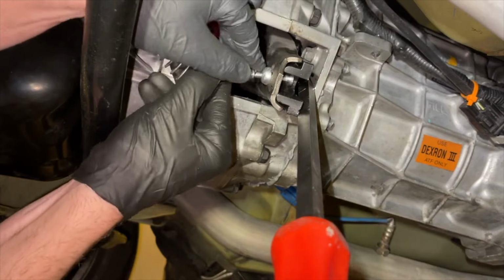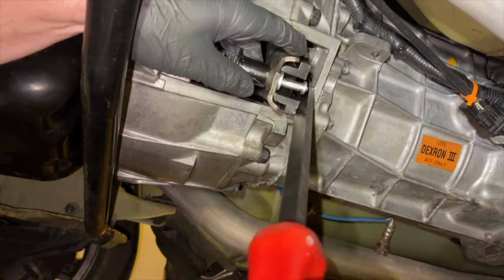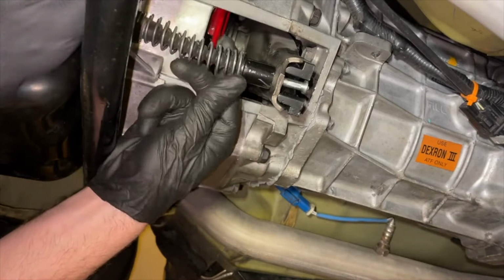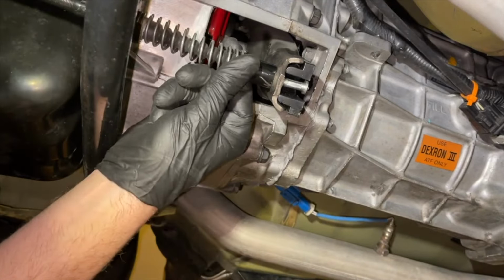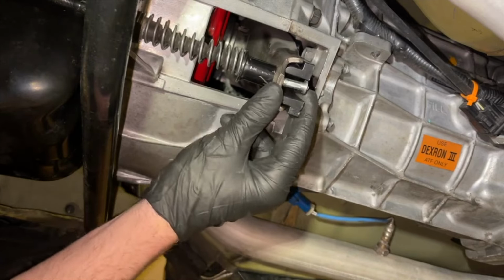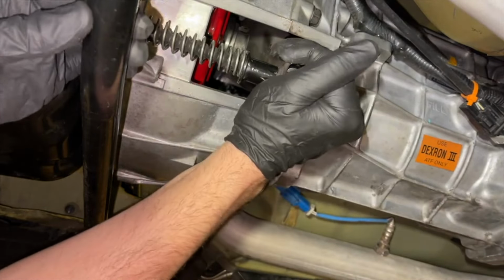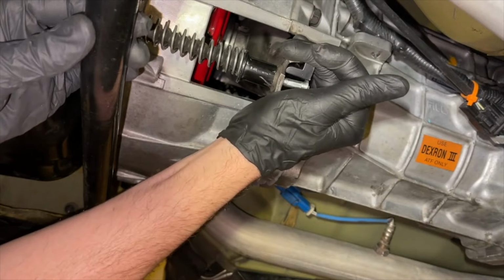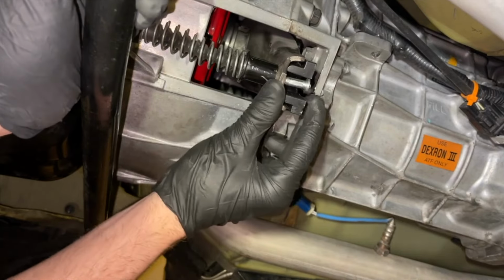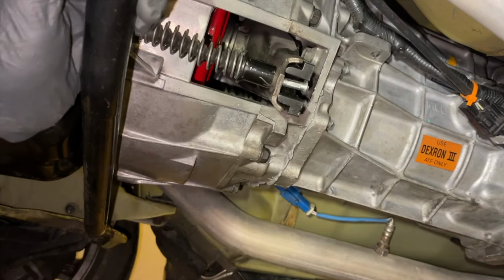So you want it adjusted properly where you don't have too much pressure on the throwout bearing, and you want to make sure that you have enough clutch travel, because if you're starting farther back and you don't have full clutch travel, then it won't disengage. You can get locked out between gears, and you can hurt the synchros if you're not fully disengaged as you're shifting gears. So this is just something we're setting up as we're setting the throwout bearing distance. If you hear that, it's just got the tiniest little click before it starts to engage, and we can adjust that out with the firewall adjuster.